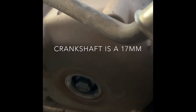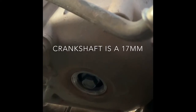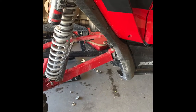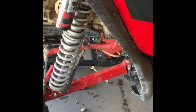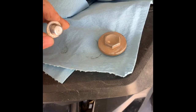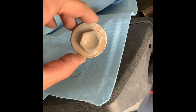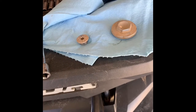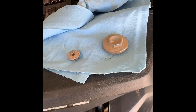Keep in mind, this is the front of the engine, and when you rotate it, it will be counterclockwise. Here we are on the passenger side of the Honda Talon. The next step is going to be to remove the timing hole cap. So you'll come up here — right there — and that's going to be a six millimeter Allen to get that off. Here's the timing hole cap, which has an O-ring still down below. Here's the 24 millimeter crankshaft hole cap, which has the O-ring built in. Those are the two things you have to remove in order to line things up before you do a valve measurement or adjustment.